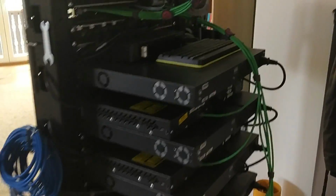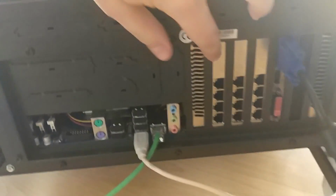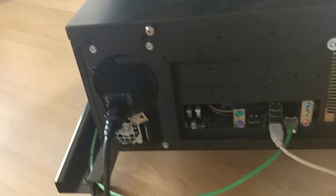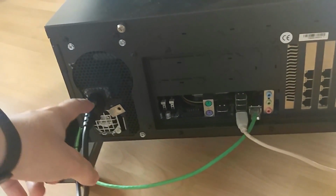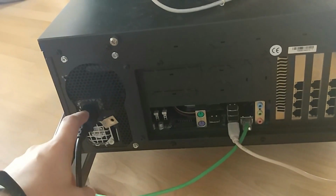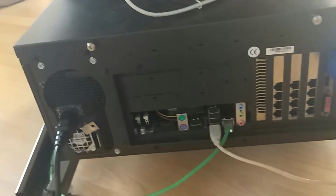And from the back, oh yeah, I didn't show you how the lab looks from the back. We'll get into all the other stuff later. From the back, as you can see, I installed 3 quad-port gigabit cards. I already had 1 gigabit connection on the motherboard. This is actually the workstation motherboard from the HP Z600. It doesn't quite fit in the ATX case, but I installed this very tiny Supermicro power supply, and since the motherboard is a little bit longer than standard ATX, I was able to fit it without any issues.